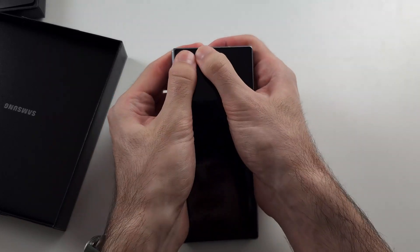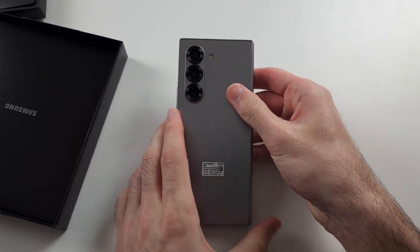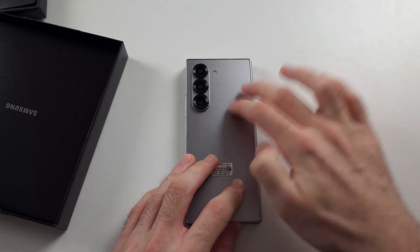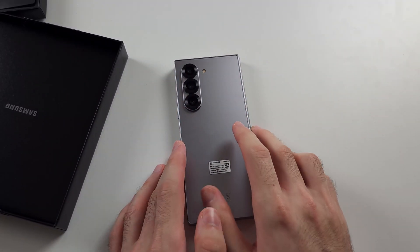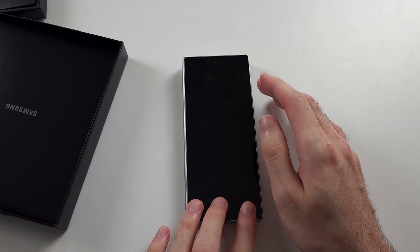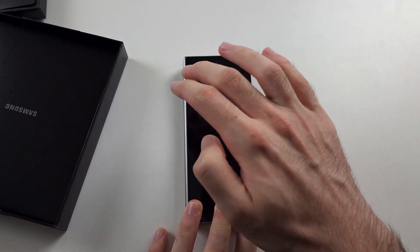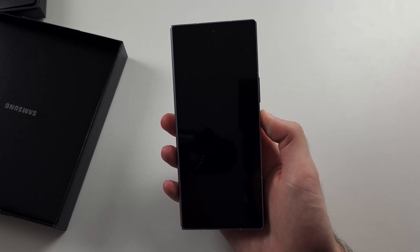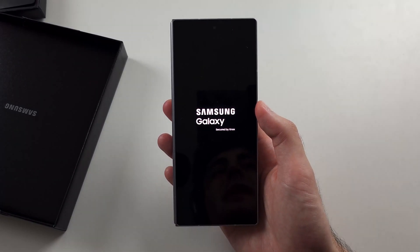Repeat this for the full back and do the same for the front as well. If you don't hear a click sound, with two fingers just tap as hard as you can all the way across the back of the phone. Spend a good five minutes on the back and on the front, putting one hand at the bottom to stabilize the phone and repeating that process. Then turn on the phone to see if it's working. If it's still not working, you will have to book your phone to be repaired by Samsung.